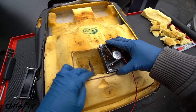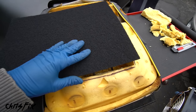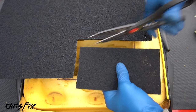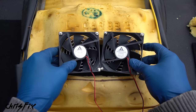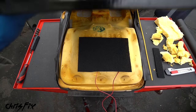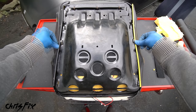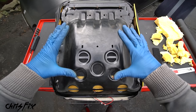The fans don't go in all the way, so there's a gap between the fan and the bottom of the seat. To fill that gap, we're going to use the activated charcoal filter — this also gives us our filtering capability to remove the smell. Line it up over the hole and cut out a few pieces to fit, layer them in so when we sit down we don't even know there's a fan under us. Add one more layer of charcoal filter on top of the fans to keep them off the metal seat bottom. Also, run wires out through the seat hole. Use wire loom protector to protect the wires from sharp metal edges that could cause chafing and a short.